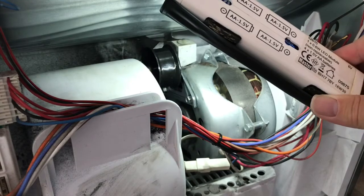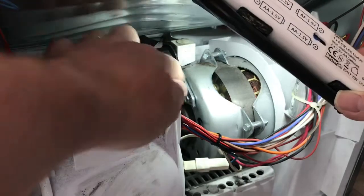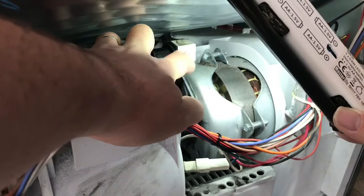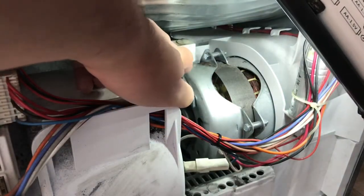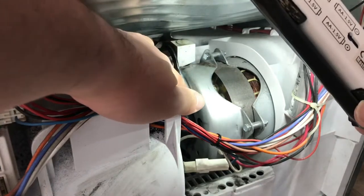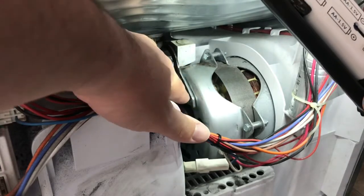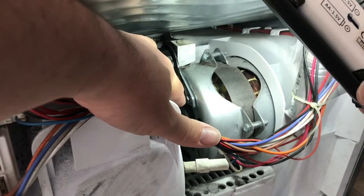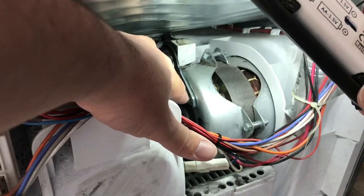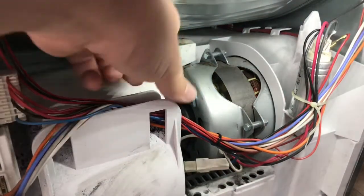And then once you're able to just slightly tighten the back screw, you can then rotate the whole thing round and then try and locate this one. It only goes in one place because there's a metal lug that sits out from the bracket, and you'll see it because it slots into a hole in this metal casing here. So you can only really locate it in one way, but if you try the back screw first and just get that located and then spin it round and do the front one, you'll find it much easier. And then that's pretty much that.